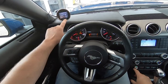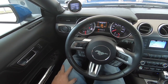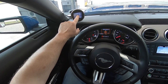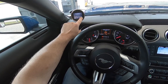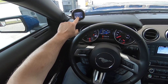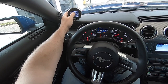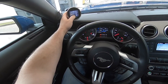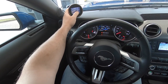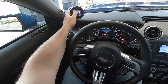Alright guys, we are going to fire this up. I've got the stock 93 tune loaded in. Now it's going to take a minute to transition over to 93 because you've got to get all the E85 out of the fuel lines. As you can tell, it's already running a little better. One short-term fuel trim I'm going to show you right now has probably gone pretty high up.